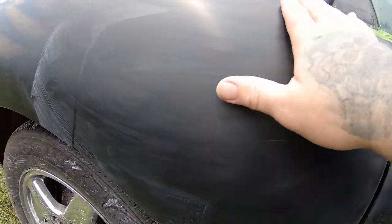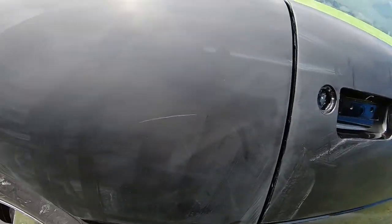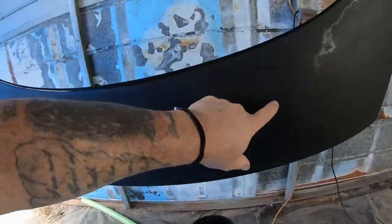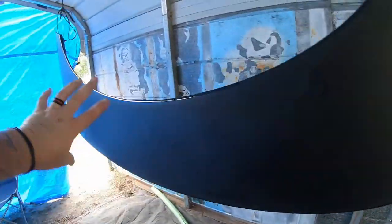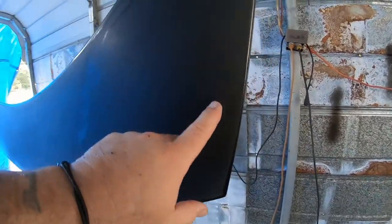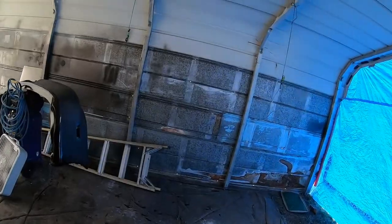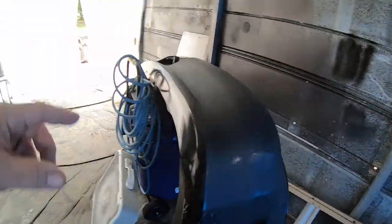Also this right here — if I'm lucky it only went down to the paint and I only have to reshoot this area to re-clear it. After I compound the rest of the car, I'm going to re-clear this whole wing on top because my mistake is right here. I've got to redo the front bumper because that thing peeled, and this just needs to be done on 2000.